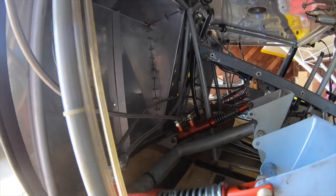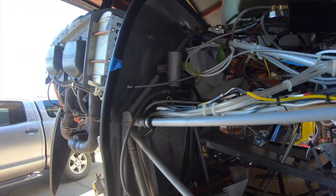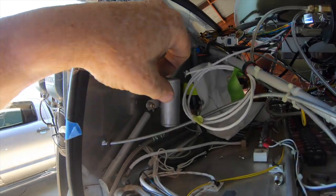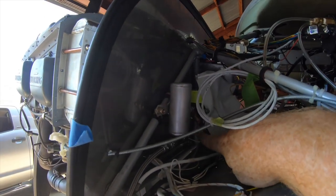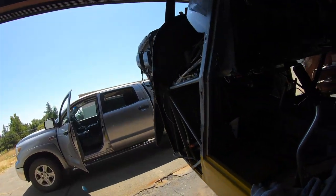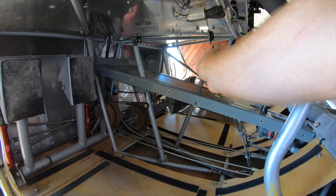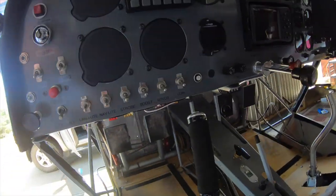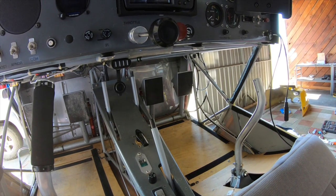You can see the crossover — the crossovers connect to the bottom from the co-pilot side, and then the top one is going up to the reservoir. I've got them crisscrossed on that, which shouldn't matter. The right side brake line comes up here and goes up to the T in the reservoir. I still have to change that out with the proper T-fitting. Both brakes are in the full forward position for the adjustability. If I push them forward, it puts the brakes back in the position I use them. This one's got too much slack in it, so I'm going to cut that one — means I have to waste a fitting, but I've got a couple extra.